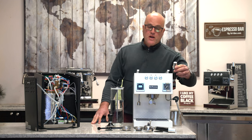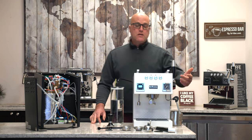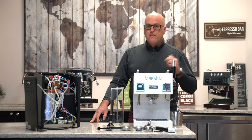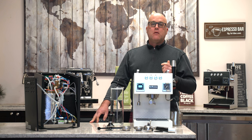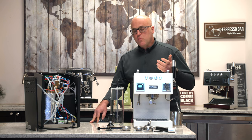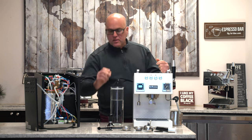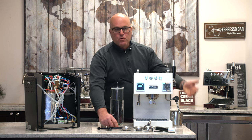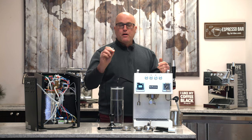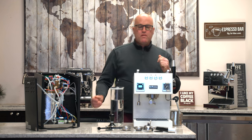As you saw in the beginning, we have a lot of steam power coming out of here. You can't manually control the steam flow — there's actually a micro switch on the inside as well as here, so it's kind of an on-off system. How did Bellezza compensate for just having it on-off, given you may have larger or smaller amounts of milk? They give you a two-hole tip, a three-hole tip which is typically installed on the machine in this batch, and a four-hole tip. The four-hole gives you more throughput; the two-hole gives you less throughput.